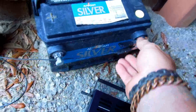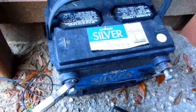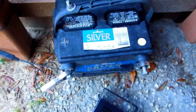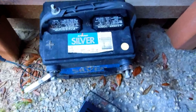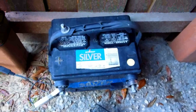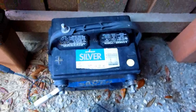There'll be a trick I'm going to be doing in a future video about fixing these batteries up. One thing you've also got to consider: this is a standard load tester, so I'm putting the same load on a 550 cranking amp battery. That's not a perfect test because it's the same load going on a 550 cranking amp battery — this is a much smaller battery. The other one was a 750, which is a Group 27, a huge battery. This would probably work fine on a four-cylinder Chevy or small V6 in a Chrysler with a lot of reliability. But six years old and five years old on the batteries, and they're still good.